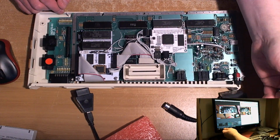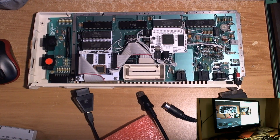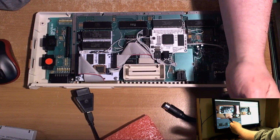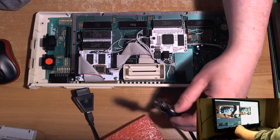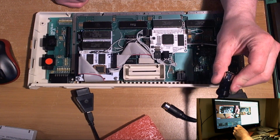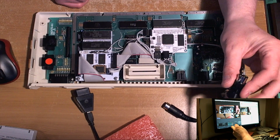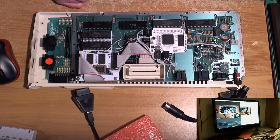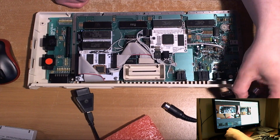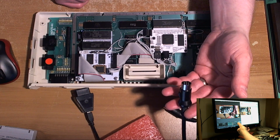I got one of these cables, the one Michael sent, and I said I would test it at some point, and I took that long to get around to testing it. It was last Friday when I first tested it, and discovered that it was never going to work, because there was no connection to the RGB blanking pin on the Scart cable. That had somehow got lost in the mix, and it was connected to composite sync along with the sync pin.